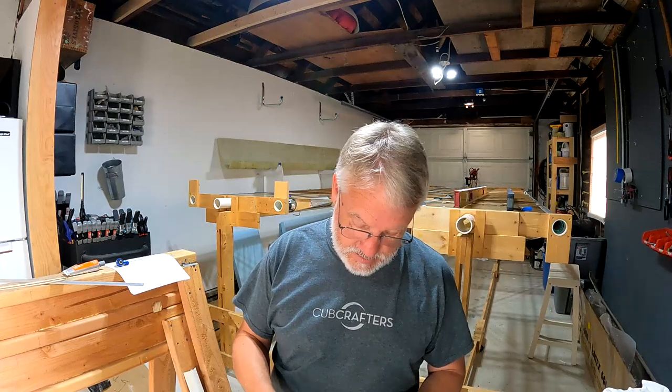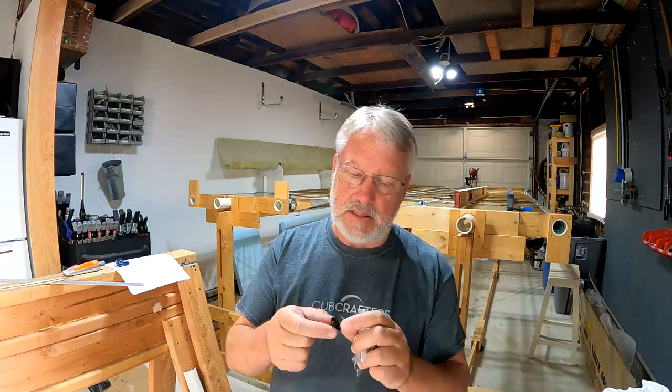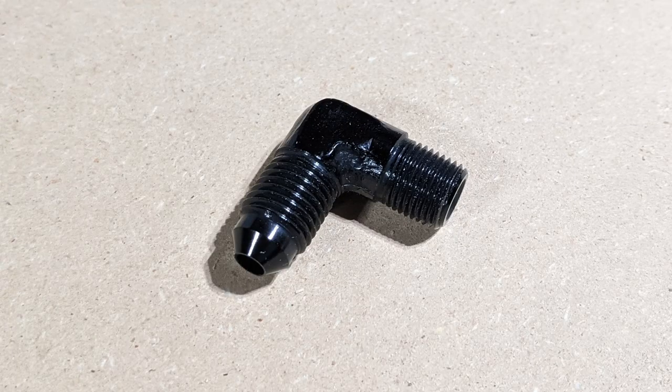I did attempt to be tricky on the hose that goes from the top of the header tank — it's a vent line which goes up to the right tank only. It's a 1/8-inch NPT, and I'm planning on using Dash 4AN hose and fittings. This is an example of why you should not order parts while sitting on the couch without actually going out and looking at your airplane. I got this elbow — 1/8-inch NPT into Dash 4AN — but the problem is that the flange on the gas tank is close enough that you can't spin this around.